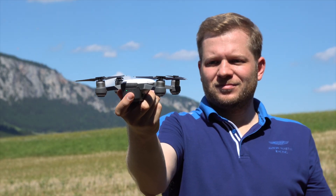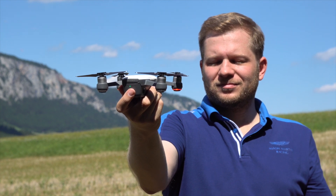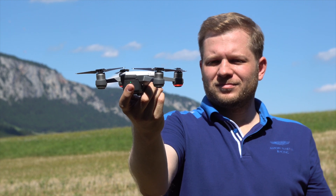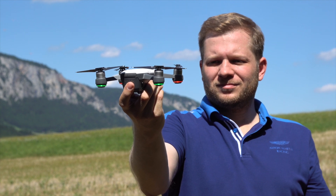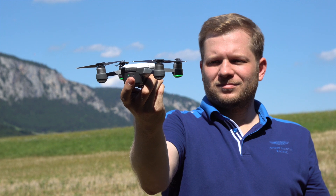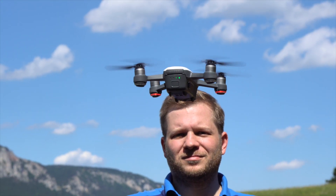Let's start with the takeoff called palm launch. After powering on DJI Spark, wait for the back LEDs to flash yellow. Tap the power button twice and the front LEDs will flash yellow slowly. The camera will detect your face, and when face-aware is active, the front LEDs turn green. The propellers start spinning and the front LEDs turn red. Now you can release your Spark and it will hover.